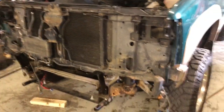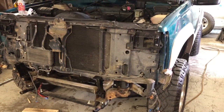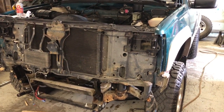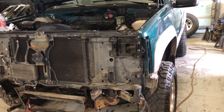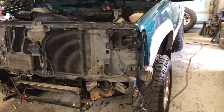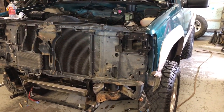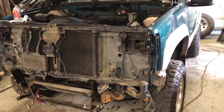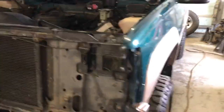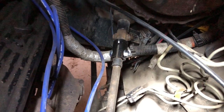The bumper bracket for the front comes with the body lift, but you have to order the bumper brackets for the rear separately. For the shifter linkage — apparently there are differences. This is a '95, so the shifter linkage actually just pulls through the floor. The rubber boot that seals the floor came through too, so you just pop that back in. If you were doing an older one, there are all sorts of little extensions you have to do. There is also a little extension for the steering shaft, which wasn't bad to do at all.